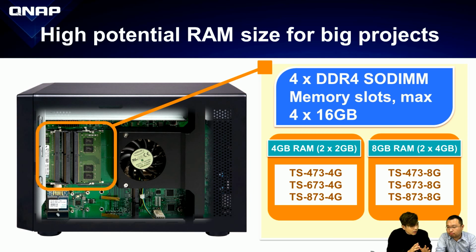So can you tell us what is the difference between 64 gigabytes and 16 gigabytes? Well, 16 times 4 is 64. Just kidding. More memory means you can run more, because QNAP NAS supports virtual machines and containers. It means you can run more virtual machines and containers on this device. For example, you can give a virtual machine 8 gigabytes of memory. Also, the more memory the NAS has, the more concurrent client connections it can support when they are transferring data, uploading and downloading. So more memory is also good for VMs, like I just mentioned, and for concurrent client access.